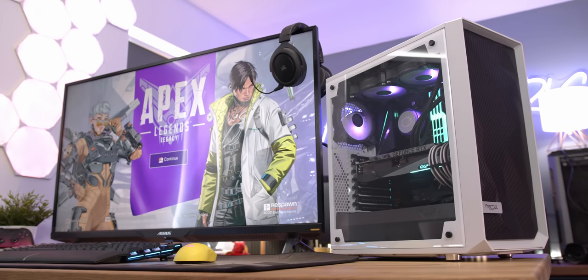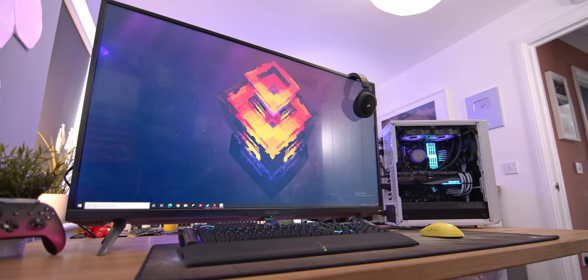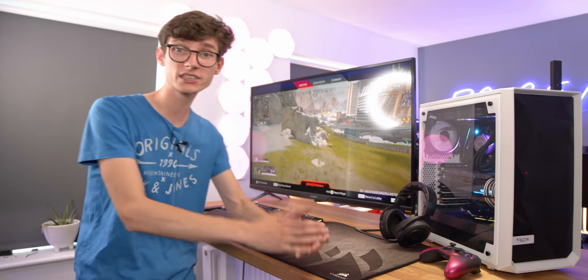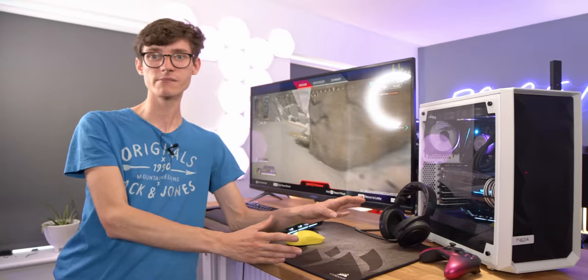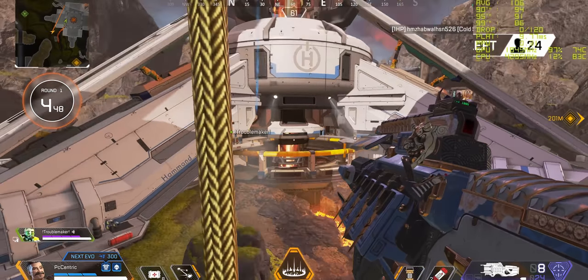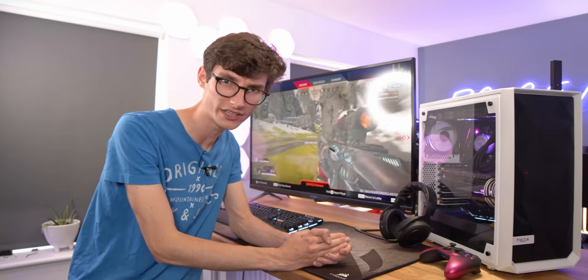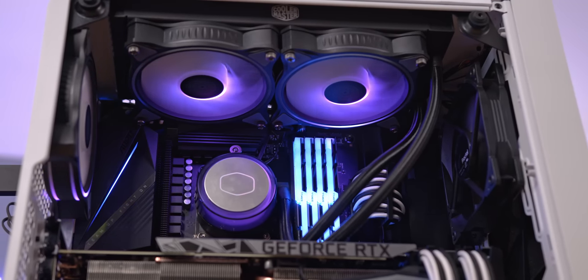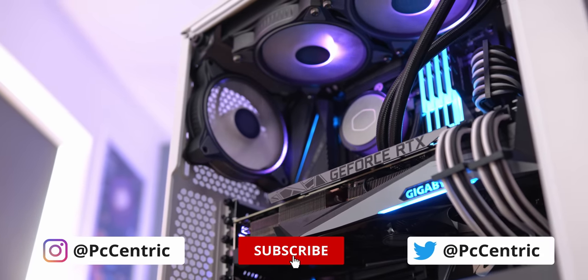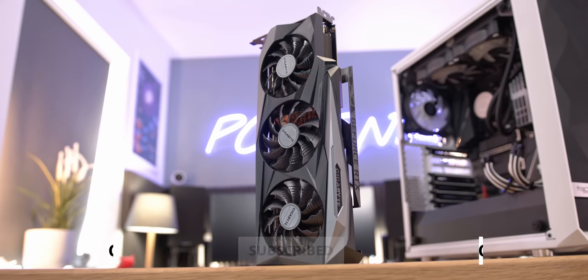So there we are then - our go big or go home overkill gaming setup. There's not really that much to dislike about it, other than thermals and acoustics. Noise levels aren't too bad for such a compact system, but in terms of temperatures on that CPU, we actually saw it hitting around about 90 degrees. I have overly aggressively tuned this for noise, so I definitely need to go back into the BIOS and tweak it - the PC will be a little bit louder, but temperatures will improve. If you want to check out current pricing on anything featured in this setup, you can find my Amazon affiliate links listed down below. Thank you so much for watching - smash that like button if you've enjoyed it, and get yourself subscribed for more just like this.